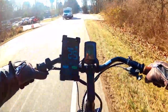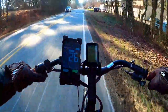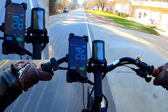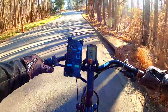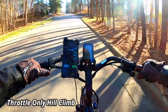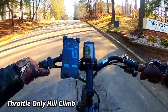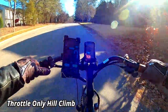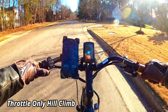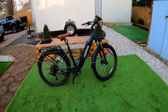For performance, I ran the same three tests I always do. Throttle only, the bike topped out at around 26 mph; with pedaling added I got about 28 mph on level ground. On the hill climb test, this was one of the slower bikes — it has one of the smaller motors — but it made it up the hill just fine. As long as you pedal to assist on steep climbs, you'll be perfectly fine. Throttle-only on a steep hill will of course cause it to struggle, but that's true of most bikes. It's adequate power, though worth noting if you live in a very hilly area.